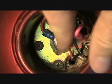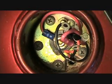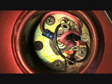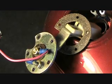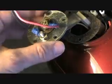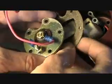So I'm going to take this bit of corrosion on the screw here to indicate that that's what's been happening. We'll try a new gasket and we'll see if it still leaks. Alright, so when we pull it out, this is the suspect gasket here. There's a float down there at the bottom, and I can't quite figure out how to get the float out of the hole. Alright, this is what the entire sender unit looks like.